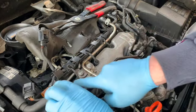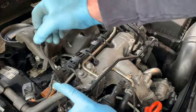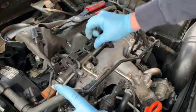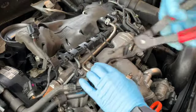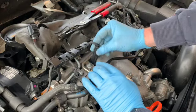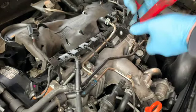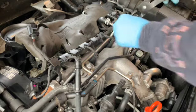That just gives us a little bit more access to the four plugs. Having undone those two, that makes life easy as well. There is a hook and a clip just on the fuel rail, so you've just got to navigate that round there just to lift it up and then give that a tug. Make sure you don't pull on the wires - just pull the plugs themselves - because if they've been in there a while, like mine, they've been in there for 10 years, they may take a little bit of effort.